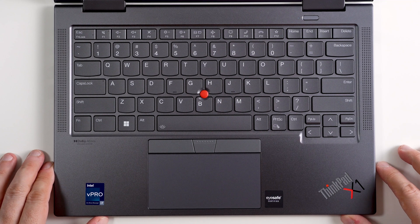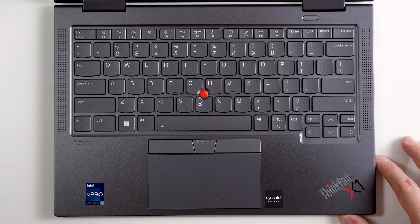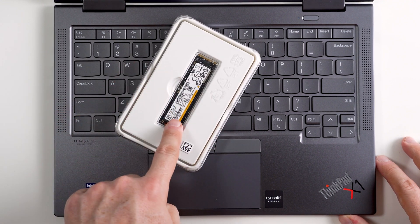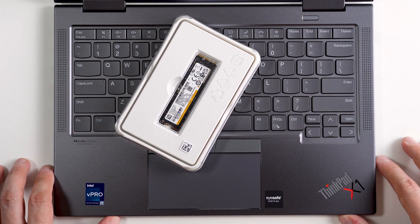Now the very last step is we have to reinstall the operating system. This laptop ships from Lenovo with Windows 11 Pro, but I'm not yet interested in using Windows 11 Pro at the moment, so I'm going to be installing Windows 10 Pro. If you want to keep Windows 11, all you would need to do is clone the data from the original drive onto the new drive. The software I normally use to clone data is Acronis — I've been using it for years. You create a bootable USB drive and boot straight from it.